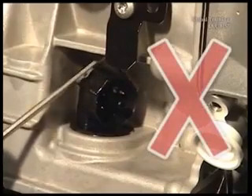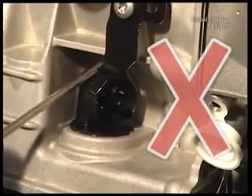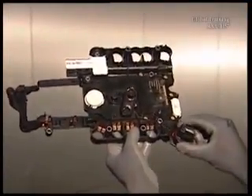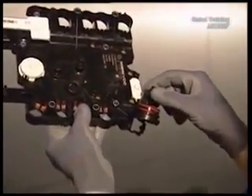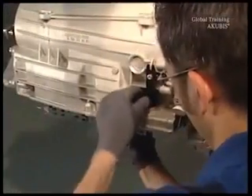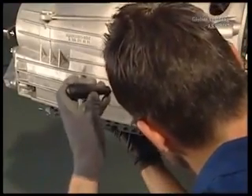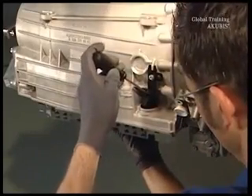Be careful. Pay particular attention to the transmission connector — it can be very firmly attached. However, if you use the wrong tool or excessive force, the connector can break off. The electronic hydraulic control unit is a sensitive component, which is completely restored at the manufacturing plant, so it's essential that it arrives there undamaged. Always try to remove it first without tools. If you can't remove the connector this way, then ensure that you only use a suitable tool — in our case, this flat blade screwdriver.